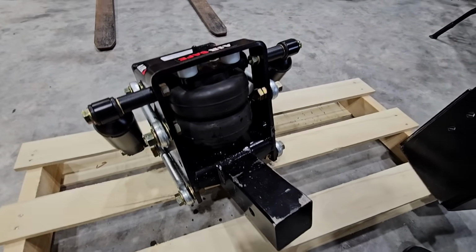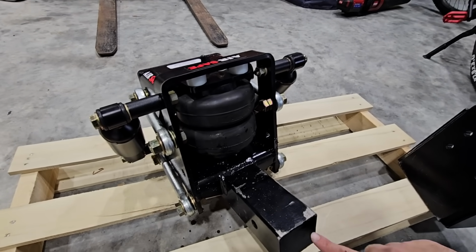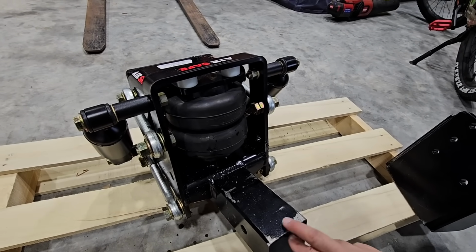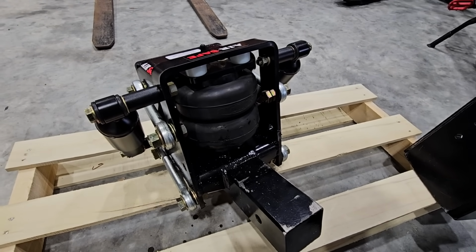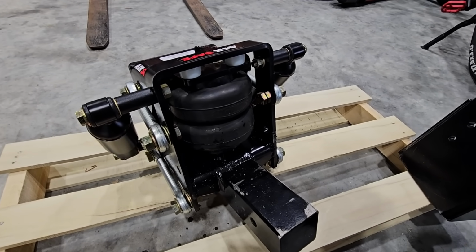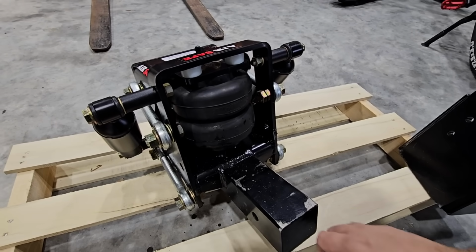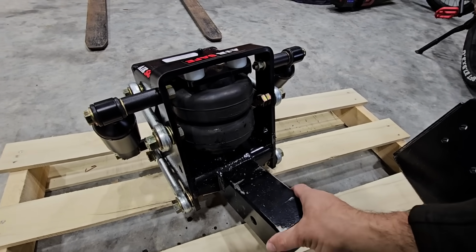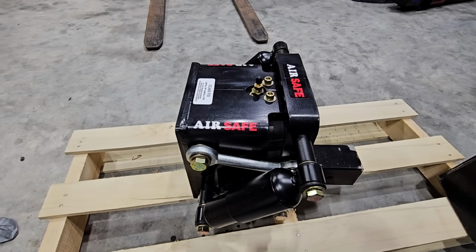Again, if we compare this to some of the others, we have the 3-inch shank version of the shocker, which is actually a hollow tube. I believe it's 1/4 inch thick sidewall material there. The B&W hitch has a solid shank, and the bulletproof hitch, which we have in the 2.5 inch shank, but they also make a 3-inch shank version, also has a solid shank back here. And this definitely is going to stick out further than any of the other products.